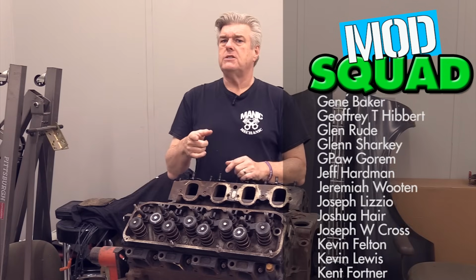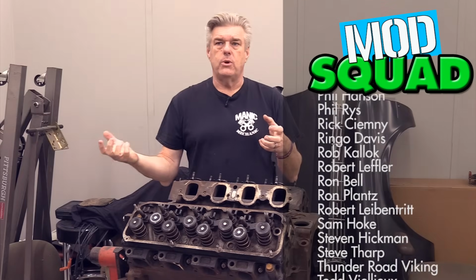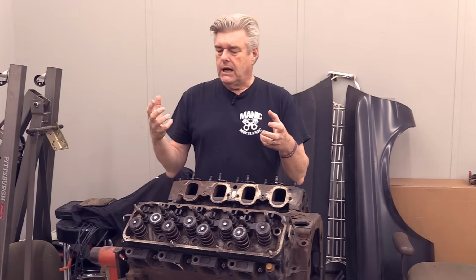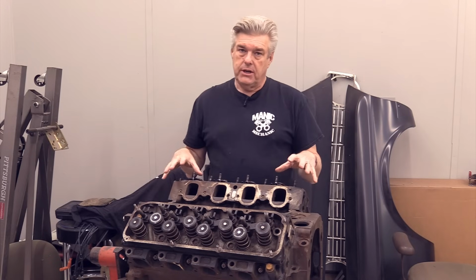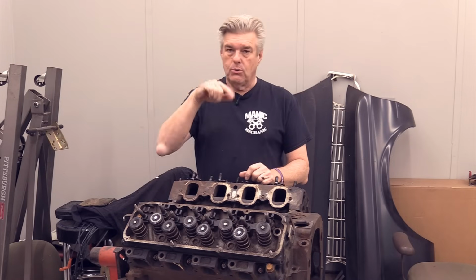Your bigger problem runs into if you're buying a 71 to 73 400 that was in a passenger car. The valve covers aren't going to be a good indicator because they were still using the original style Ford, Powered by Ford valve covers then, and not just the blue oval valve covers they went to in 75.